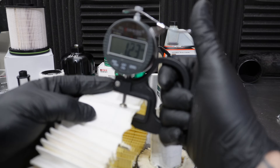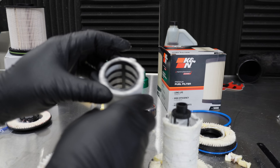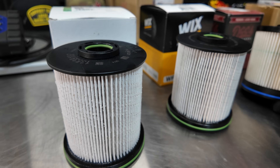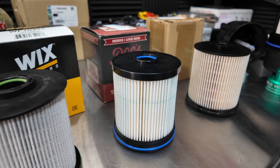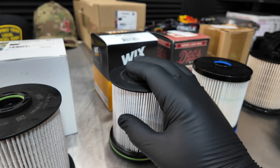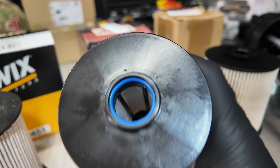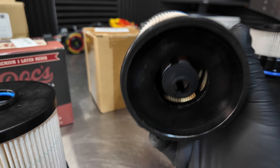I did a cutaway video with the K&N fuel filter — if you want a closer look at how this filter looks inside, I recommend you check that out. But I want to point out one thing: based on the K&N cutaway, the internal media that grabs the water is actually a lot thinner than the AC Delco one. So that tells me the AC Delco will most likely do a better job at filtering out the water and dropping it into the bowl. This Dox filter looks like a good filter and seems like a good value. And if you go to the Wix site and pull up the Wix part number, they actually show a fuel filter pictured just like this. So no matter which of these three you get, you can't go wrong. You're going to pay more for the Wix — in my honest opinion, AC Delco is the best value, it's kind of the gold standard. This one also looks like a very fine filter and I would not hesitate to run it.